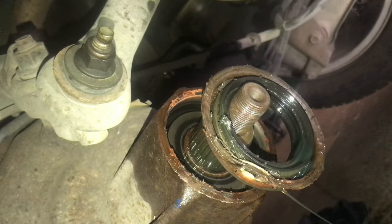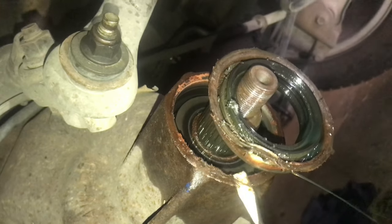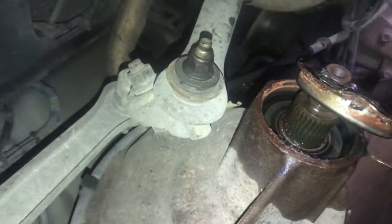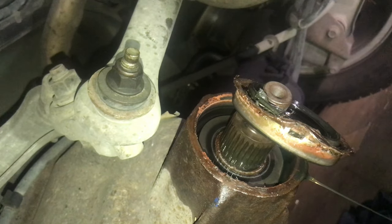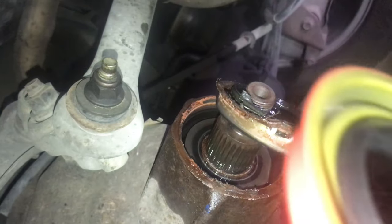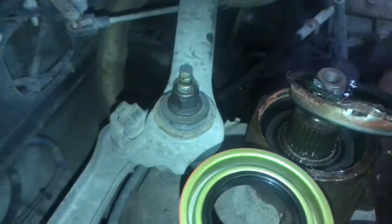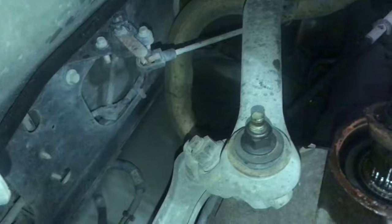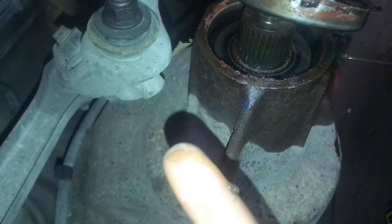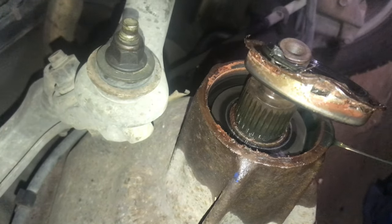I decided to go ahead and do it myself, and it's only been about an hour but this is really like a 30-minute job with the right tools. I got my seal from O'Reilly's — it's the Seal Master Pro, about a six-dollar seal. If you order it online it costs a lot more. Look at how the seal goes on: it goes on this way, not on top. It should match up with that seat. You want to do this while you're changing your differential fluid. The fluid honestly looks brand new — not dirty, not old — but I still want the Lucas oil in there for its additives.